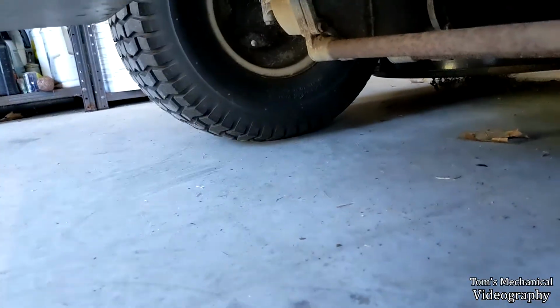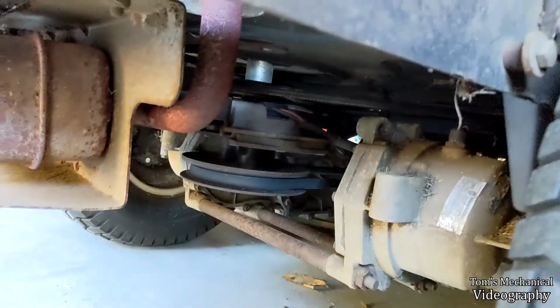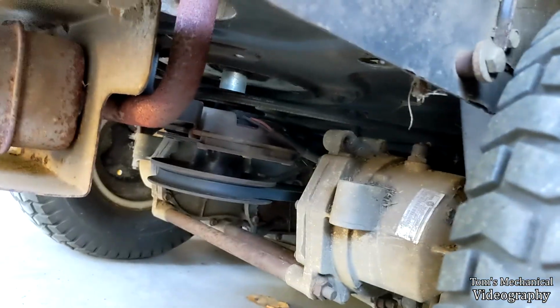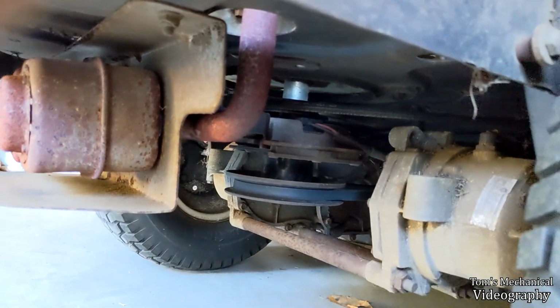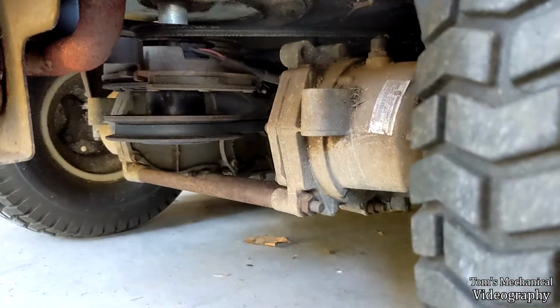But there's this right here, and that's welded to the frame up there, and that's inside of those little ears on the clutch. So I'm going to have to drop the clutch and disconnect that wire up there simultaneously, just to be able to get this thing around it. And I'm hoping I can just take that bolt off and the whole thing's just spline and it pops right off. And if it doesn't, then I'll cry.